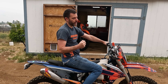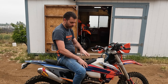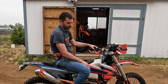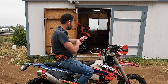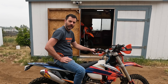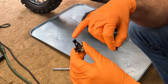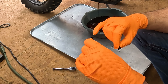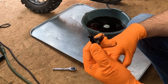Clutch pulled in all the way and the bike's just dragging badly. Before you dig into the clutch stack itself, definitely make sure your levers are set correctly and you don't have a problem with oil level or something like that. In this case those things are okay, so we're going to pull this bike into the shop. I'm draining the oil because I wanted to change it anyway — there's some debris including what look like clutch fibers, so that's one thing you'll want to check to see if stuff's coming apart in the engine.